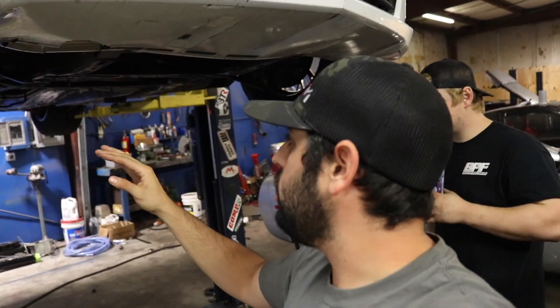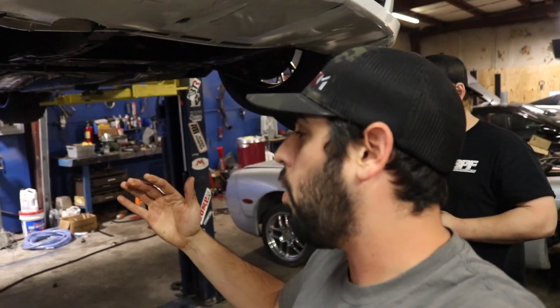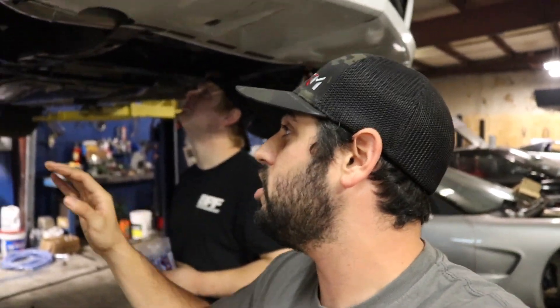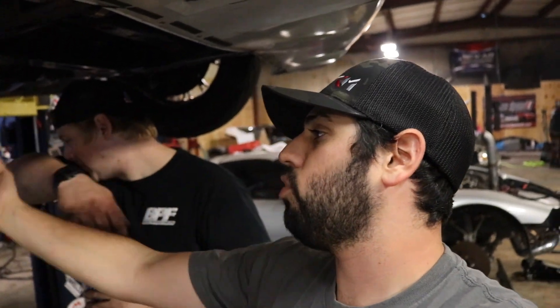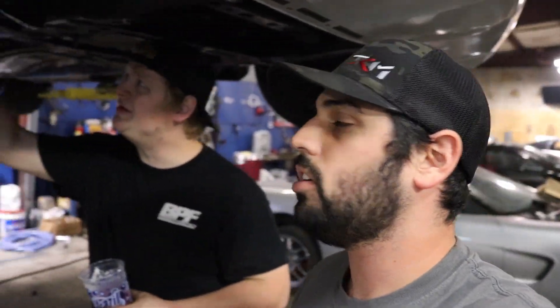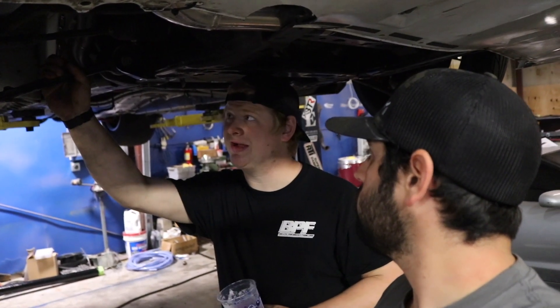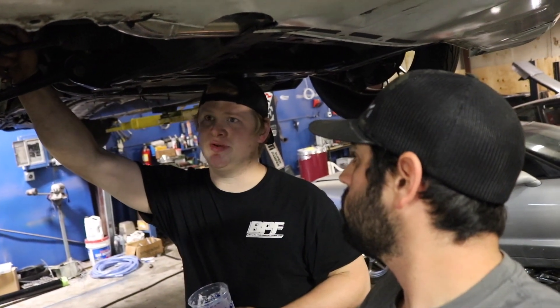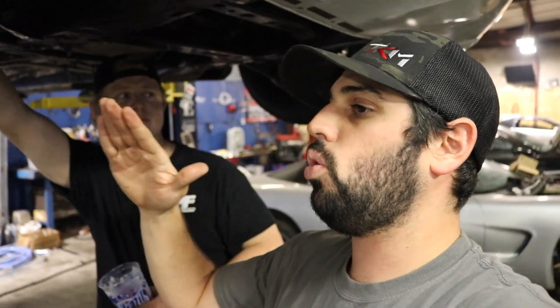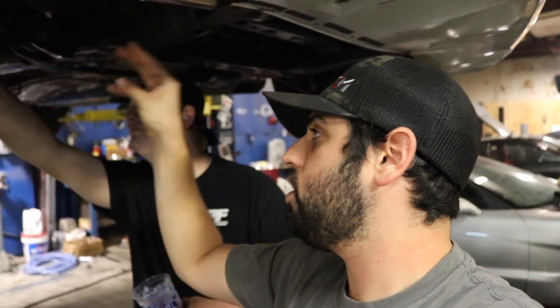You need to drive it like a forklift with the rear end. You need to get the timing right, figure out how much front-end travel the car likes horsepower-wise, then find out where it is and limit it. Front-end travel is very crucial to track conditions: if you're at a bad track, you need more travel to help throw more weight back there and hold it. If you're on a real tight track, you want to tie it down — too much travel and it's either going to bob because it's planting the tire so hard, or it's going to try to wheel it. But for a 5th Gen Camaro making 800 horsepower and having trouble hooking up, you need travel limiters regardless of how good the track is. You have to stop the extension at some point because if not, it'll knock tires off at 10 feet every time. It literally had like eight or nine inches of front-end travel before and would just pick the nose up and hold it all the way down track.